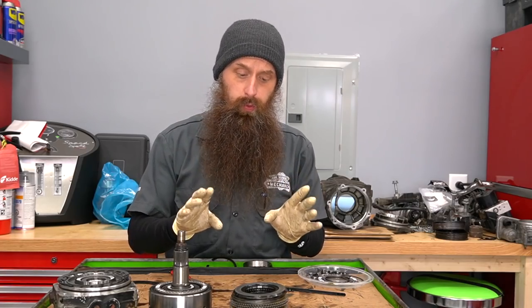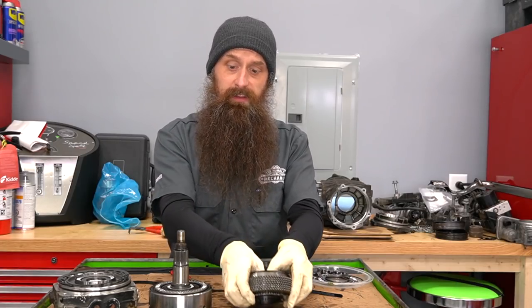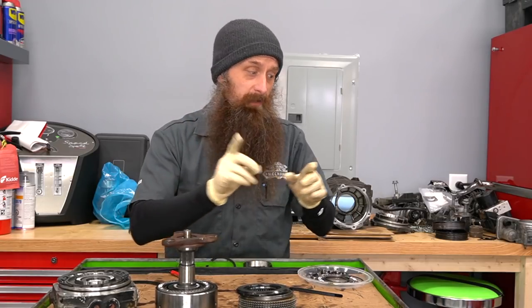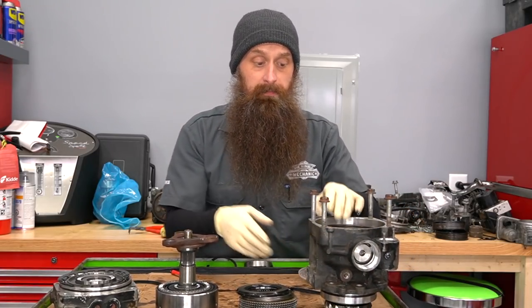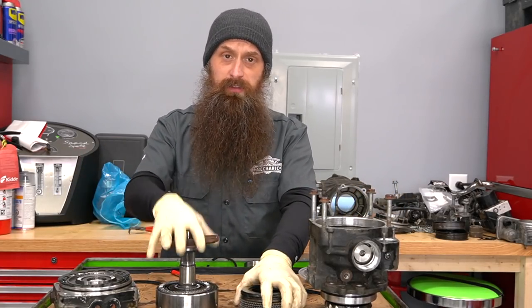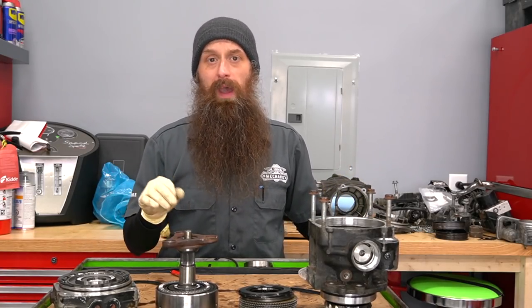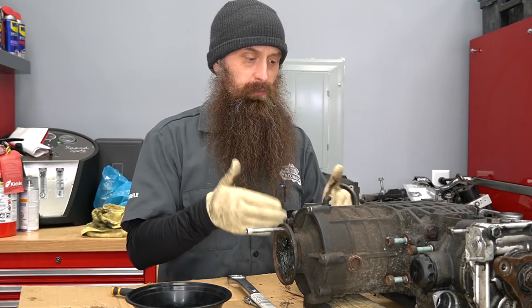What we do with a tune or an upgraded controller is increase how much pressure and how soon it's applied to give a more thorough all-wheel drive system. Some dude in Italy actually designed a replacement for this entire clutch pack that's one solid unit, permanently splined from the drum to the output side that drives the ring and pinion gear — giving you a more full-time all-wheel drive system instead of what we sometimes call fake all-wheel drive. Short of a pump motor failing, this is actually a pretty good system and it works really well for what it is.